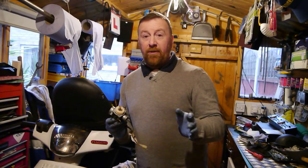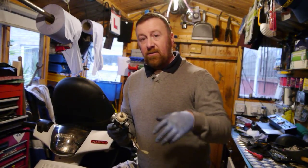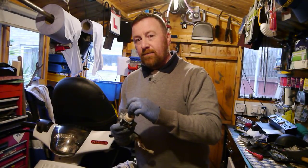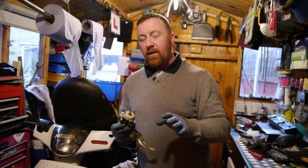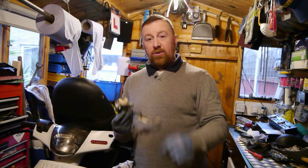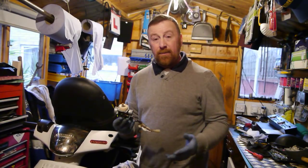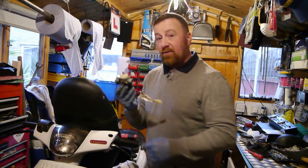This goes right back to what I said in my very first videos — a couple of years back now — that I'd rather have a bike that just died than a bike that someone's already played with. And again, the shop changed the exhaust but never changed the jet. They could get it started every time; the next person couldn't. That happened to me because I didn't check it. This jet change will now solve the problem.